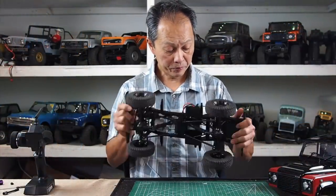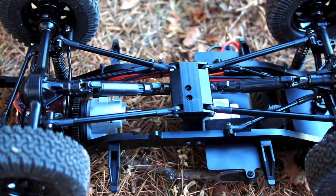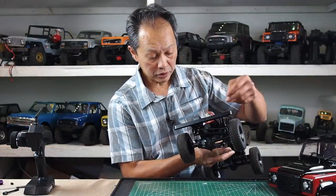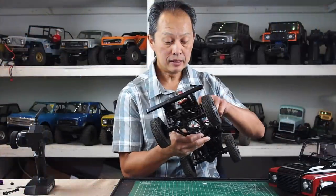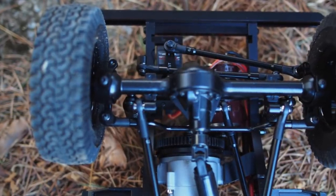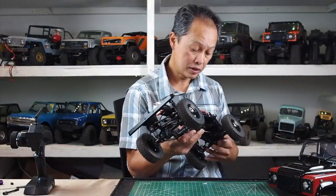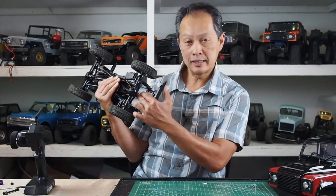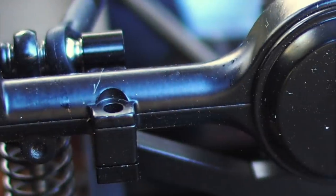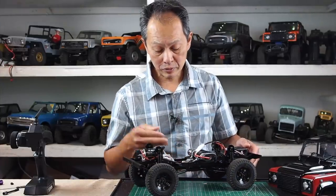It has these Yota 2 axles — offset in the front, four-link in the rear, three-link in front with a panhard bar. No bump steer: the geometry is correct. The steering rod that connects the two wheels together is behind the axle, which gives better clearance so you can get over stuff a little better and cleaner too. It's got a bar where the links attach — a little cleaner design. And I believe these axles are deep-spring ready if you want to go that route.